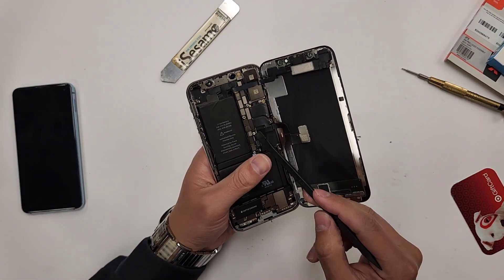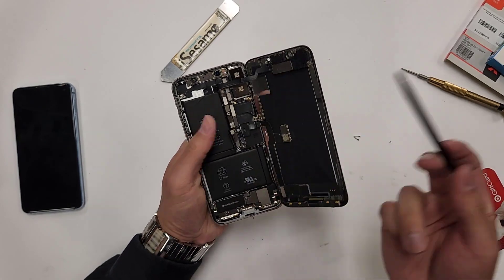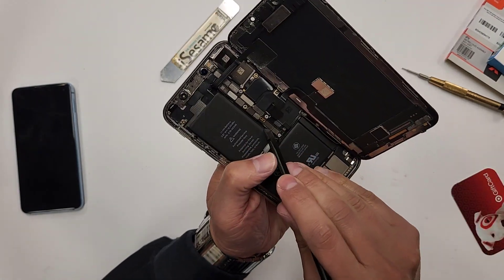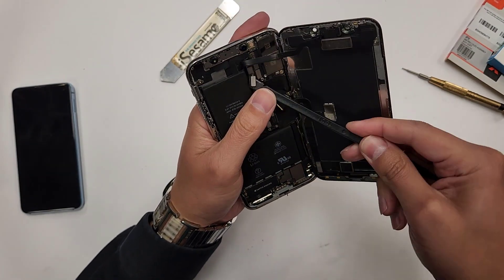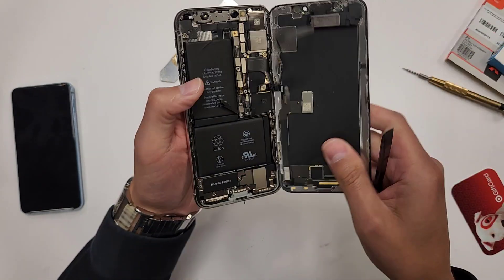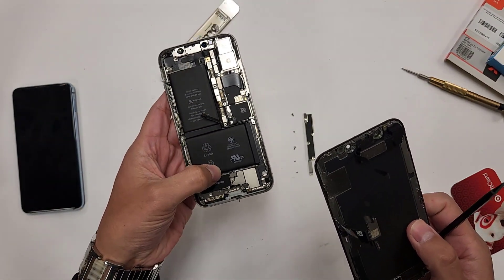What I'm going to do first is unplug the battery — it is this connection right here, you can see. And then I'm going to start unplugging the screen. You can just follow the cable right there. And then I'm going to unplug the ear speaker connection right here. There's usually always adhesive right here — I kind of pluck it out like this.